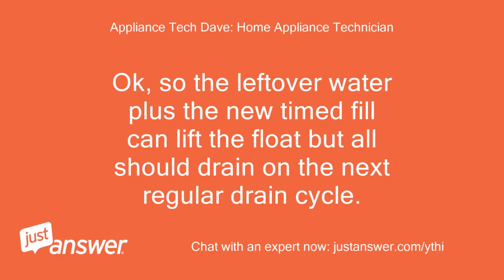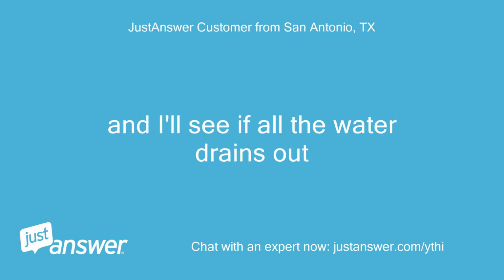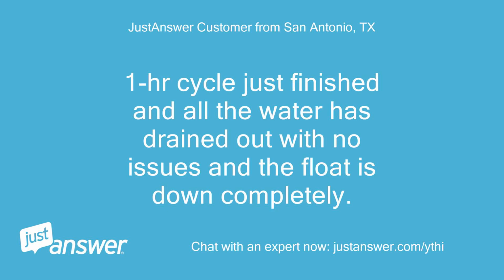Okay, so the leftover water plus the new timed fill can lift the float, but all should drain on the next regular drain cycle. Okay, finishing the cycle now, and I'll see if all the water drains out. The 1 hour cycle just finished and all the water has drained out with no issues and the float is down completely.